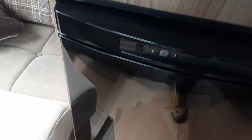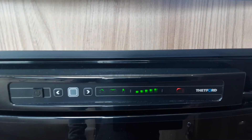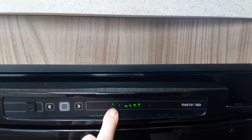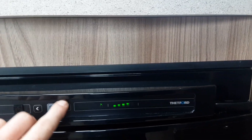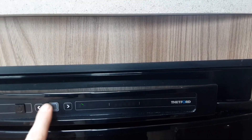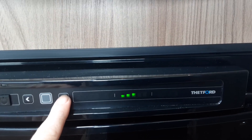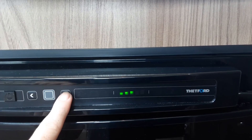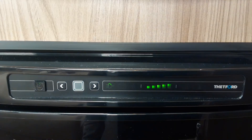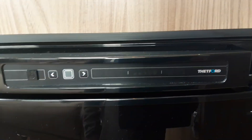With the fridge, fairly straightforward to use — not much different to how they've been for quite a few years now. Power on. At the moment it's trying to ignite on gas — it will fail to ignite because the gas bottle isn't turned on on this particular van. To change the power supply, you press and hold the grey button, come across with the arrow to the one that's relevant to yourself — so at the moment we'll go 240 mains. Hit the grey button again, and before it stops flashing you can control the temperature of the fridge and set where you want it to be. You'd hit the grey button to set that, and to turn the fridge off you'd press and hold the power button on the end. The screen will go dark when the power has been selected.